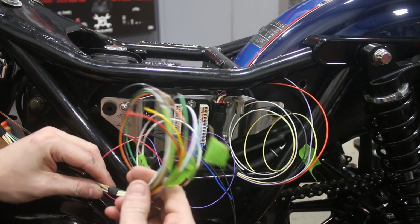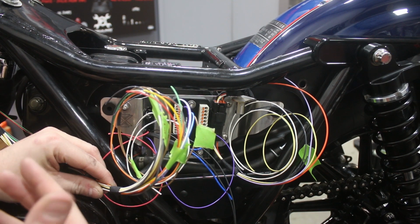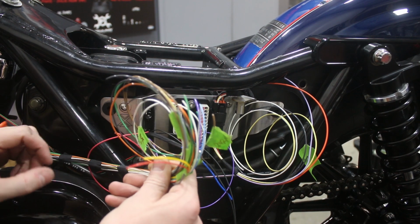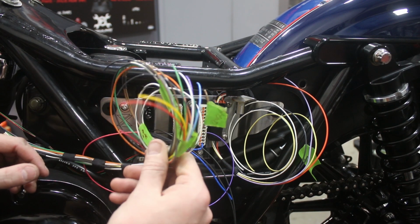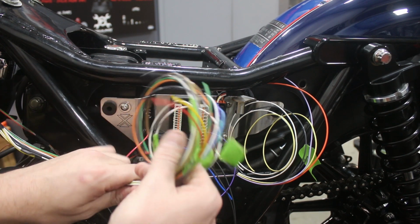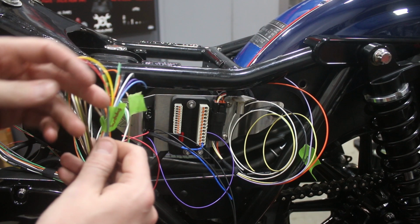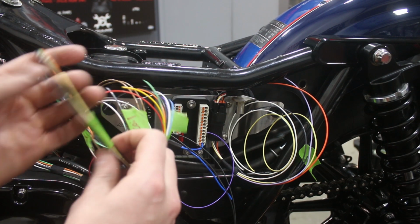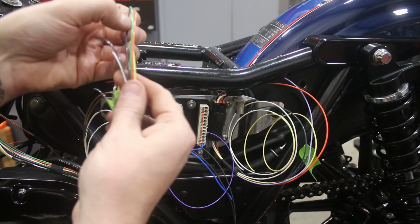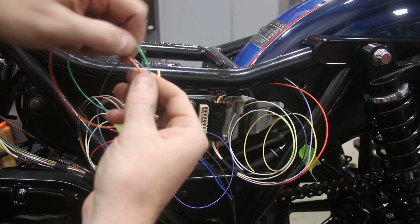And one thing you want to be careful of here is that you've got wiring diagrams, either that you made or were provided, for all the various switches, the pinouts, and theoretically you'd be able to tell what wire is what based on that. But once you bundle multiple connectors together, the pinouts are going to overlap in terms of wire colors, so there's going to be some duplication in here. You used to be able to tell them apart because the harnesses were separate, but once you merge them together, it all becomes one. So you want to label the things that you want to make sure you can tell apart. For example, we didn't label every individual wire, but this is one bundle right here that I labeled lights, and what we've got in here is 2 ground wires, which are black, and then our 2 turn signal wires, and then our 2 high beam and low beam headlight wires.